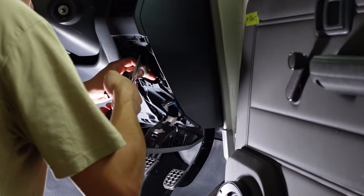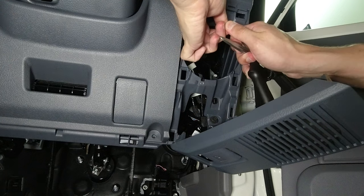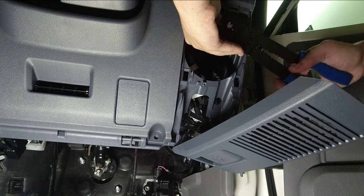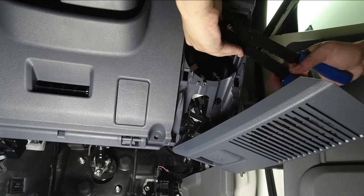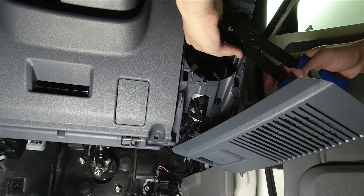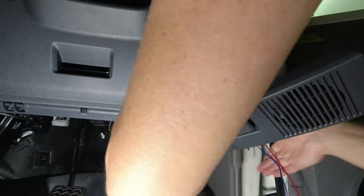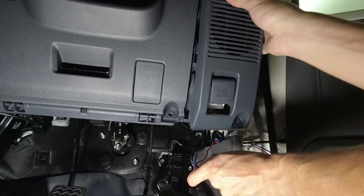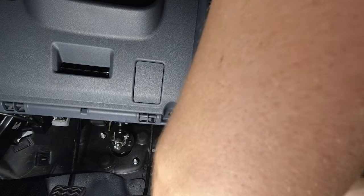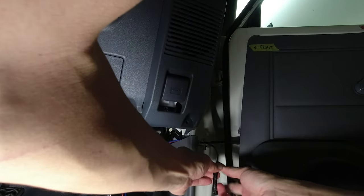Now it's time to remove the factory speaker cover by undoing the two 10mm bolts and removing the speaker which is also held in by two 10mm bolts. The plug on the end of the factory loom is a motor company loom and isn't reusable for this install, so I cut it off and replaced it with opposite spade terminals to plug into the end of my custom loom. Toyota doesn't use red and black wires to indicate positive and negative, so I always used the darker colour wire as the negative — or you could test with a voltmeter. I also had to cut back some of the factory sheathing as it didn't leave much room for the terminals. I ran the wires into the cabin through the gaps around the door hinge — that turned out to be a really good way to get them into the vehicle. There was only enough room for the two wires and no sheathing, so I wrapped the wires in electrical tape instead to protect them from rubbing on the metal.